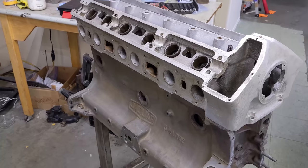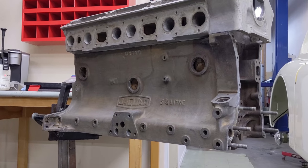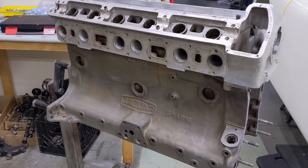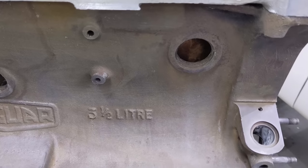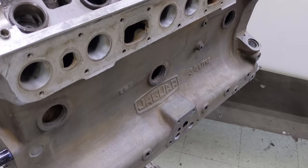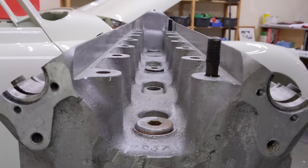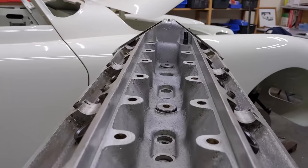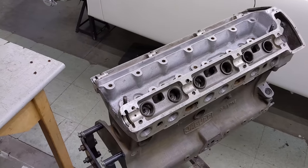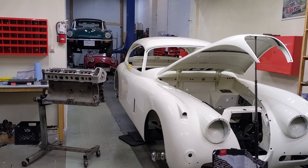What did I do to the block? It's been hot tank dipped - that got rid of all the oil. But to get rid of the rust I give it a mild acid wash and definitely have to wash and rinse that out after - can't leave acid on a block. And just poking to the right there is the XK150 project everybody wants to see. So please let me know if you want me to follow up on this XK motor, see how we do on that cylinder head, go through the parts ordering process, maybe see what we order in - a little bit of the build and seeing it running. That XK150 in behind there is taking up all my time. As always, if you have any tips, tricks, comments, or trade secrets, I'd love to hear from you guys in the comments below. Thanks for watching everybody, see you later.